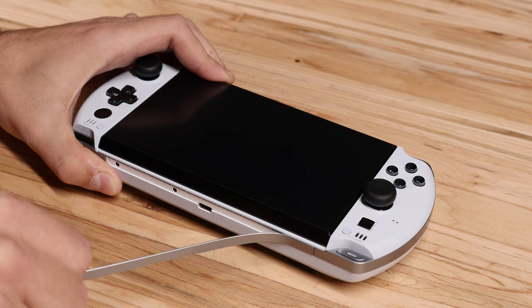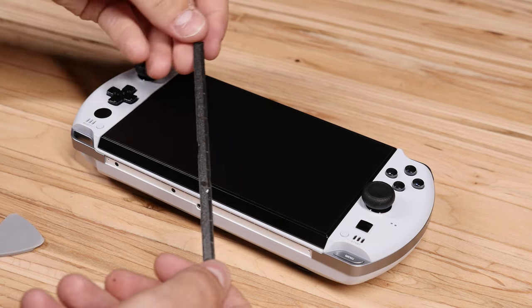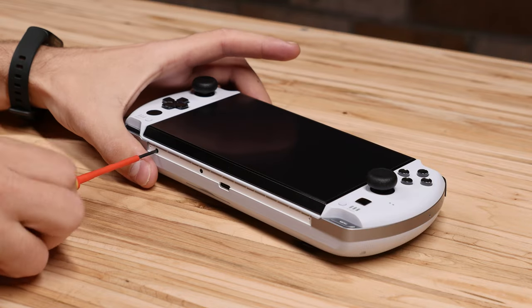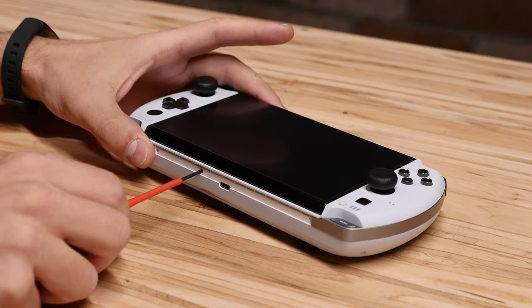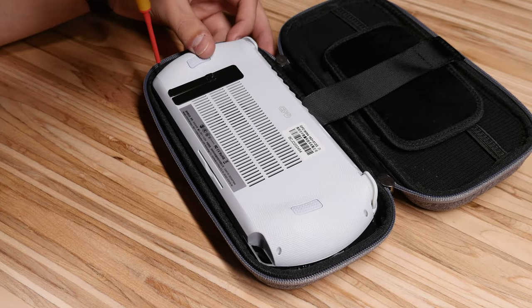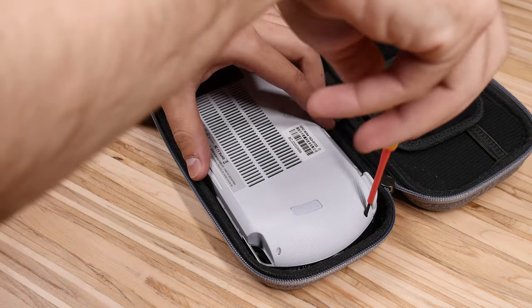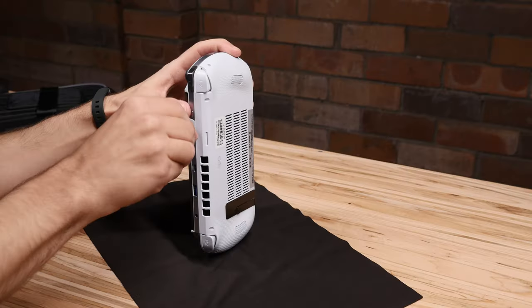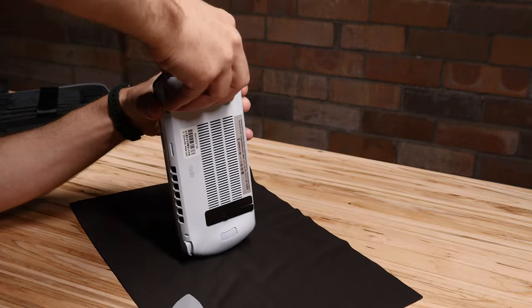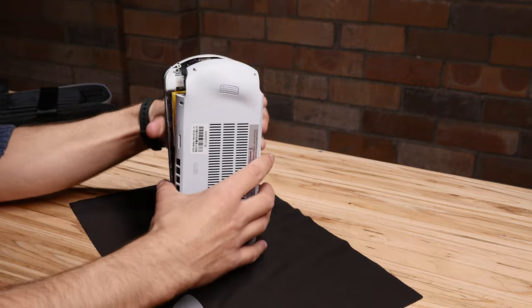You don't want to keep replacing these covers, so it's not an ideal solution. However, with a hairdryer I was able to remove it very easily with no damage and got it back on at the end as well. Once you're done with that, remove the other six screws found on the back of the unit. I'm using my case here to lay it flat and protect the screen and thumbsticks, but I end up just laying it flat on a microfiber cloth. To get the back cover off, I tried prying it with a plastic clip but in the end I managed to simply pull it off with my hand.